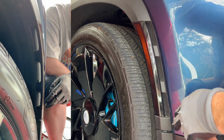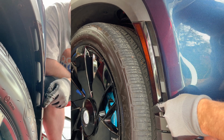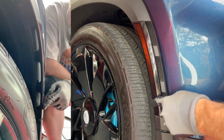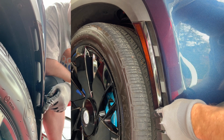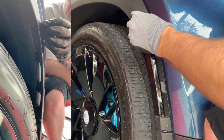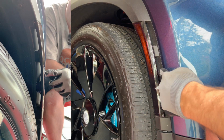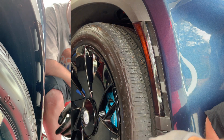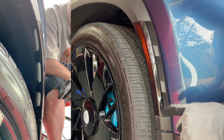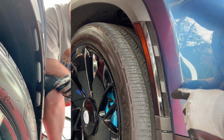And I must say, it looks pretty good. The only thing on the surface is there's a couple of indentations that are part of the reflector. There's a little bump here, and there's some little writing on the side here. But do your best to press it down and then use the heat gun to get all the edges, and you want those to be all around. You want to push it as far back as possible so it surrounds the entire reflector. And that's it. So I'm going to do this again on the driver's side with just the regular matte black vinyl.